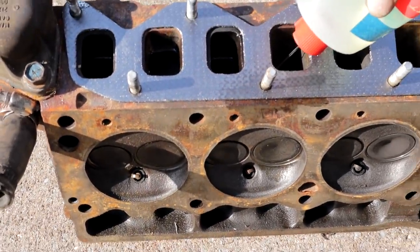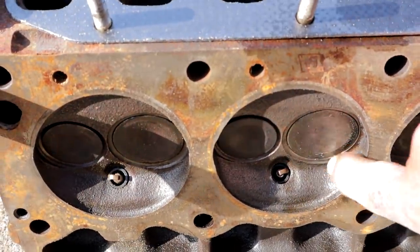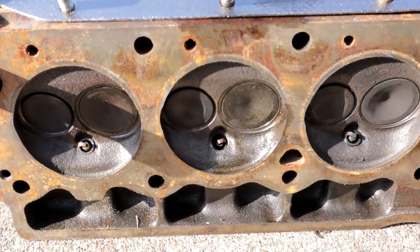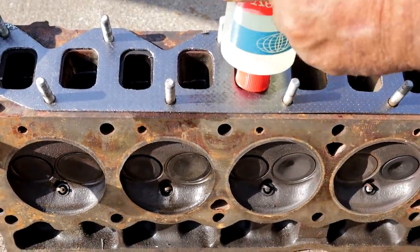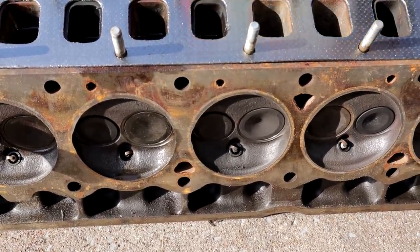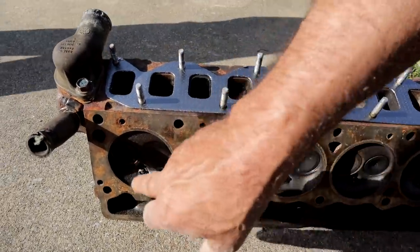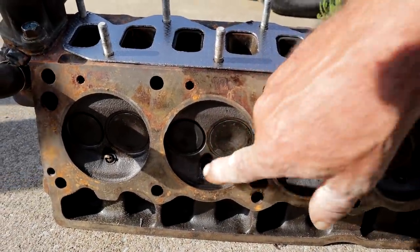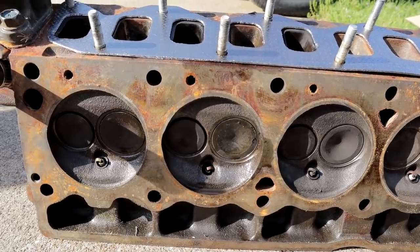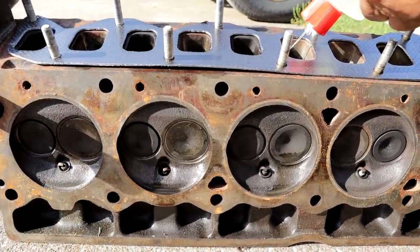We have no leakage past the valve so far... oh yes we do. So here's an intake valve that's leaking. Stubbe, you had no compression on number one and number two? Both one and two. Here's one — the valve's sealing. Here's two where you had no compression, and the intake valve is leaking. You had weak rings on one cylinder and a weak valve seal on the other. And there's your compression loss. Look at the way it's just running out of the intake valve.